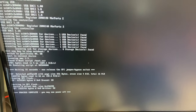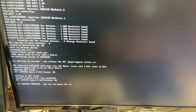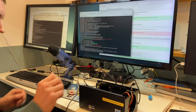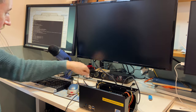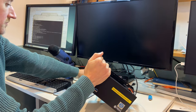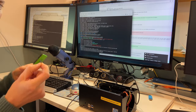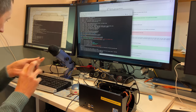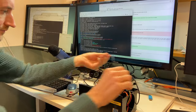You can now see that it has flashed the U-boot bootloader to SPI. It says 'process complete, you may now power off.' I've switched the KVM back to my x86 machine. The next step is to remove the microSD card from the RockPro64, because we now need to write the Slackware installer to it. I'll put it back into the adapter and back into the first USB socket.